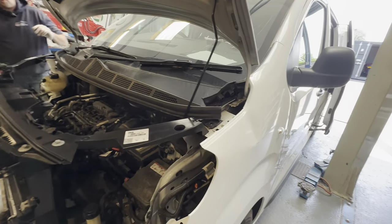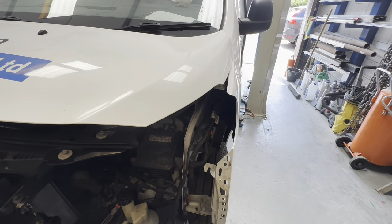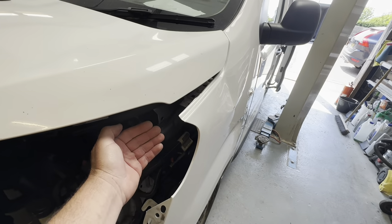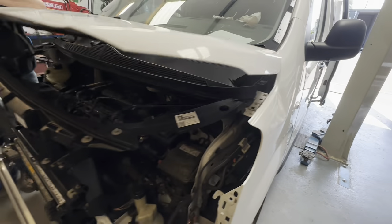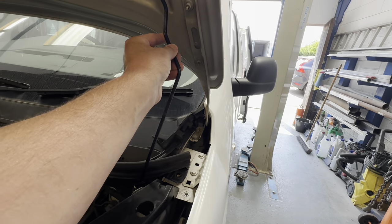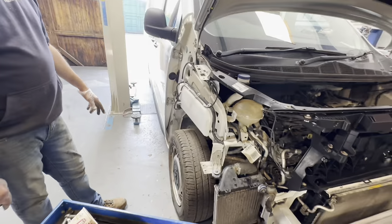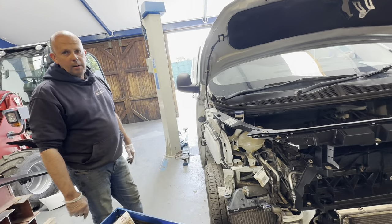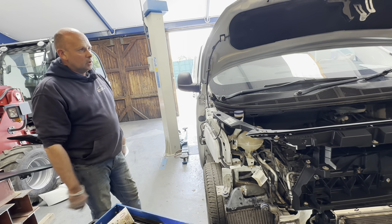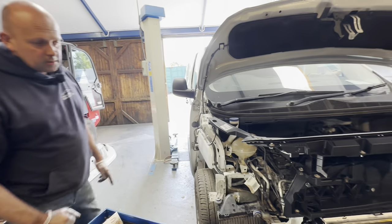We know that wing on that side has got some damage on it. You think it's just tweaked out a bit - if you shut the bonnet you can see. That dent is only caused by the headlight having pushed that wing. Once you pull the wing back around, a lot of that will pull and push at the same time and sort itself out. That's it - and new wing this side. I'm going to do a repair on that door too, just to get the wing on so we can put the headlight, bumper, and grille on and make sure it all lines up.